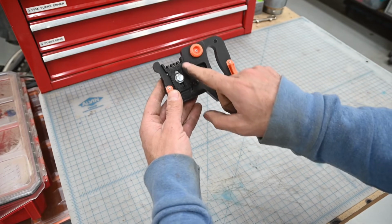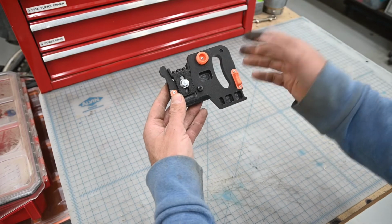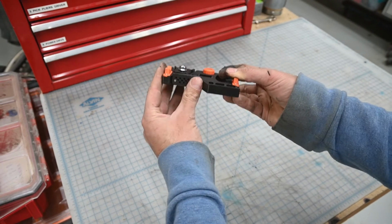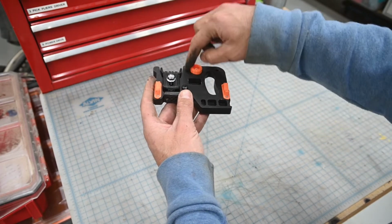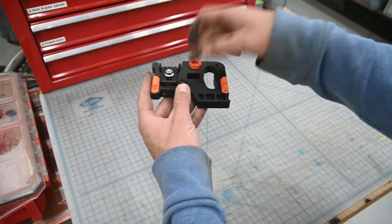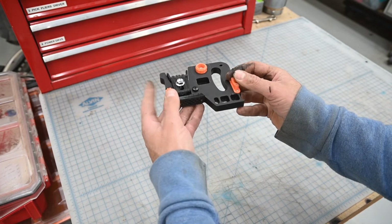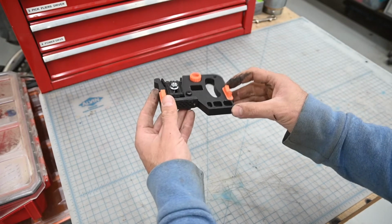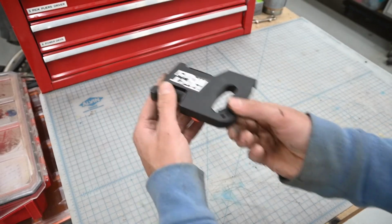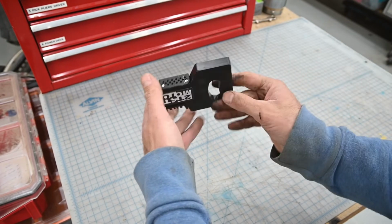So you have the slider, which basically sets your chain tension, and that is set per your manual or per your preference. You have this base plate, which lets the tool sit into the swing arm. And then you have these other little features. This holds your nut in place when it's on the floor, and this slot can hold a collar or a washer. And then you have these other raised features which hold your axle across on the floor. And then you have this wedge feature here, which helps you lock that wheel back, like I showed, or lock the wheel forward when you rotate the wheel back and it wedges itself.